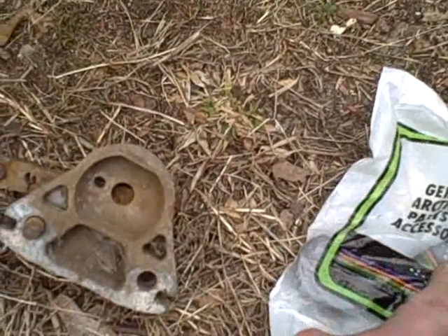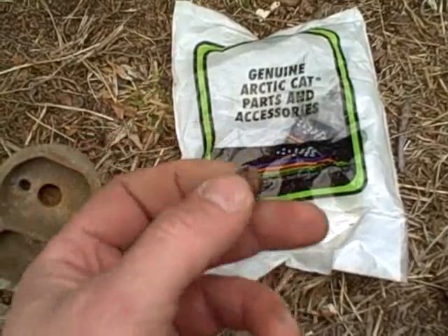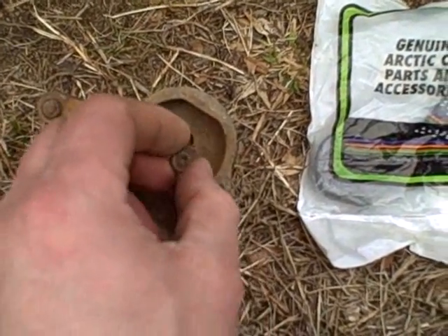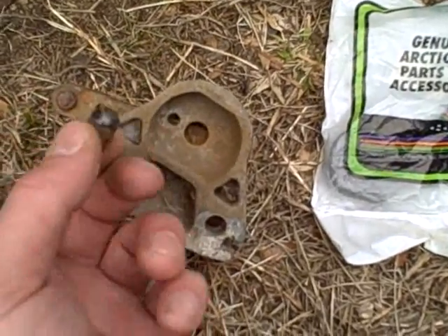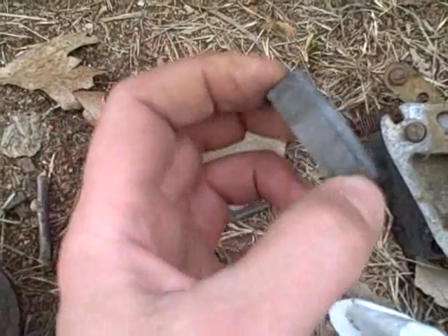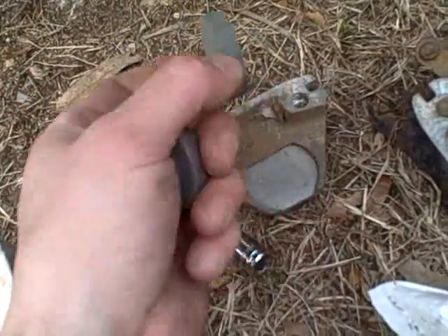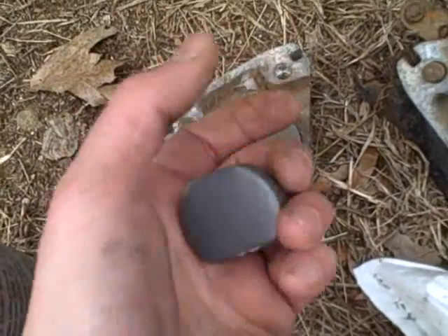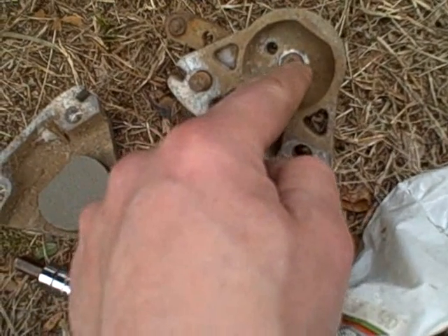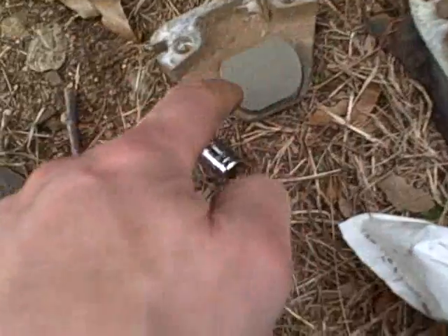I picked up brand new genuine Arctic Cat pads on eBay — the seller accepted a price of eight bucks on them, so I'm happy with that. I'm going to put just a small dab of grease on this rounded area where it's going to engage that cammed area, being careful not to get any grease on the pads. I noticed there's actually a difference between the two pads: one pad has a little metal plate bonded to it and the other does not. I'm going to place the pad without the plate on the fully supported side of the caliper, and the pad with the metal plate on the side where pressure is concentrated by that small piece — otherwise that pad might want to crack.